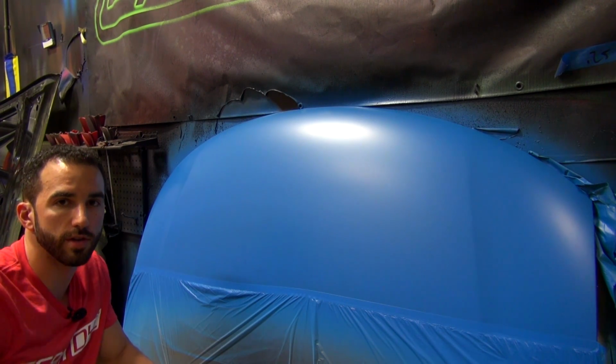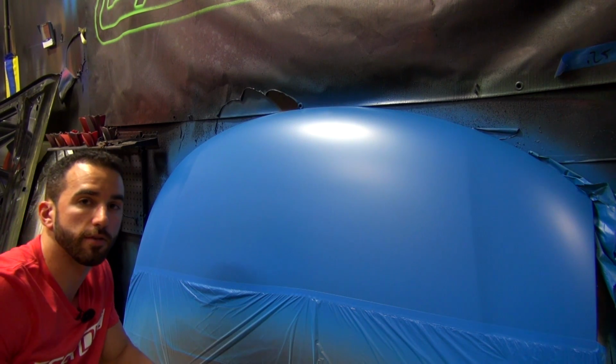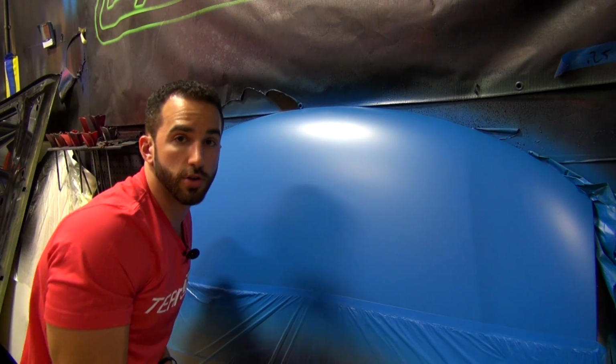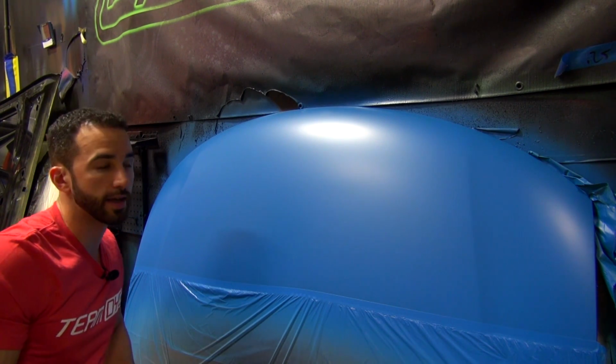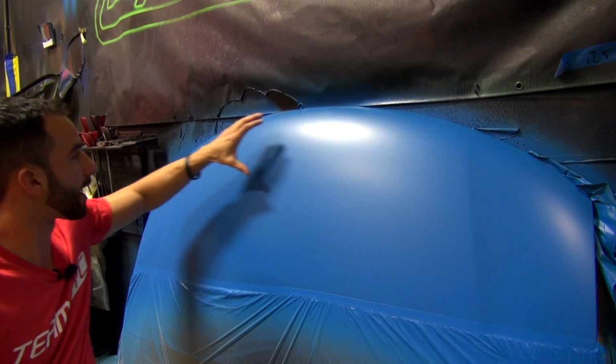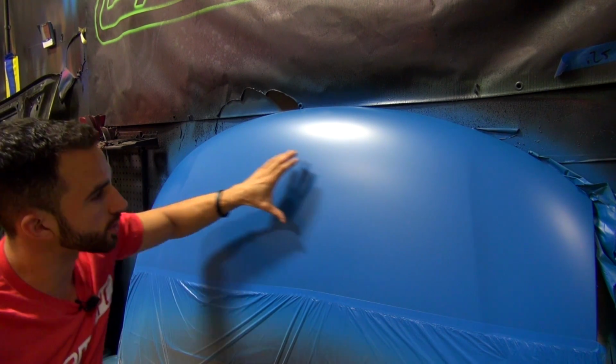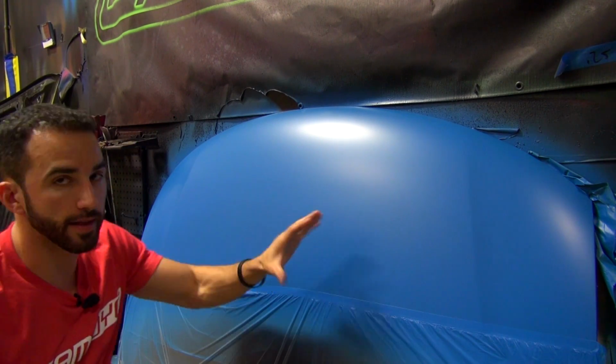And again, we're going to go over this a little bit more in depth in the gloss part of the video. And if I repeat myself a million times in this video, I actually just don't care, because I really want you guys to retain this stuff. So I'm going to start putting my pearl coats on with a 50% overlap, drawing a wet edge across the entire hood, and then step back.